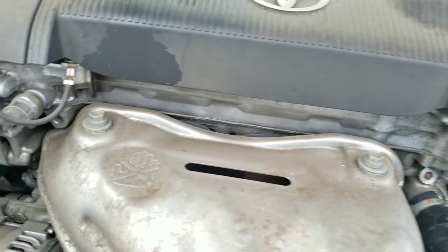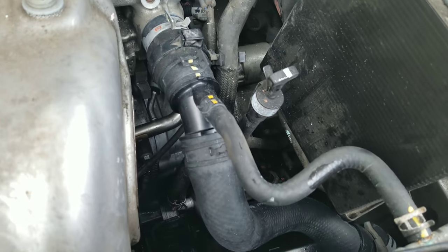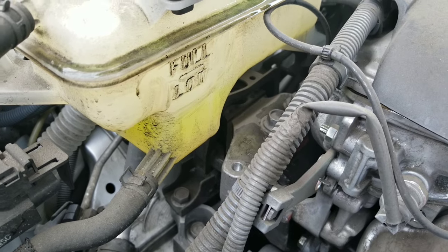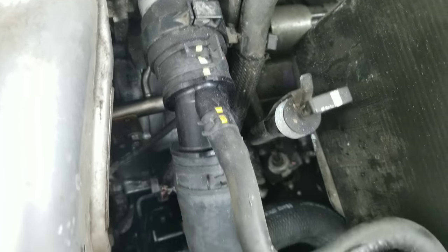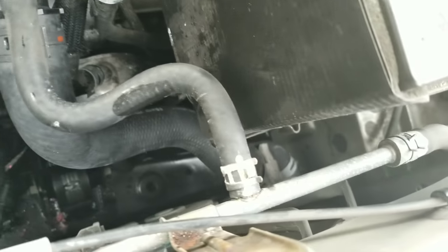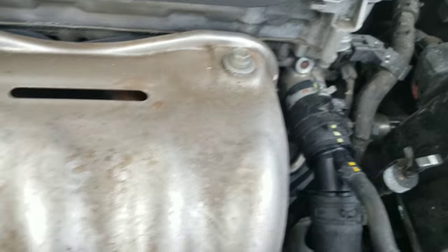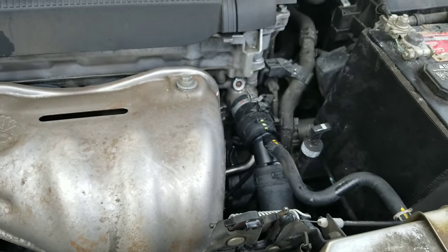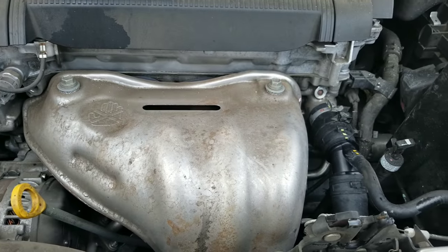The car is now running. What you'll notice is that the coolant level drops, so once you start the car again check your coolant levels because it's going to drop and you'll need to add a little bit more coolant. The new hose and connector are fully installed. For parts and coolant, this cost about $40 — the estimate I had from the mechanic was about $200.